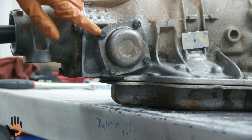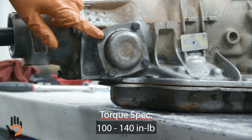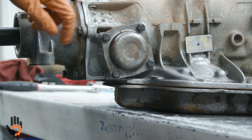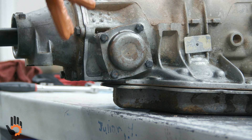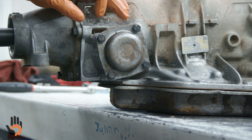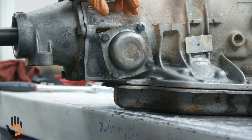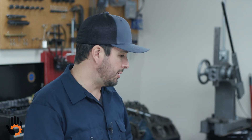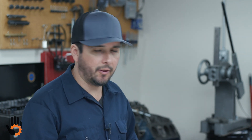The governor — we like to torque these bolts to 70 inch-pounds. They get torqued in a star pattern, and we'll make one last pass all the way around the cover just to make sure we didn't miss any bolts. This is a fiber gasket, so we'll actually torque it several times because the gasket will crush and compress as we torque those bolts. And yes, 70 inch-pounds is just what we like to use on this governor cover.